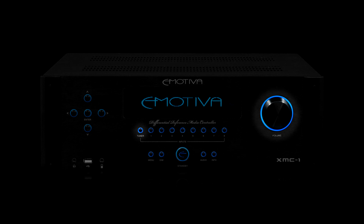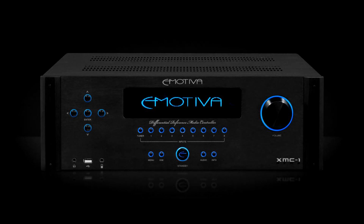To tune to a different frequency, turn the volume knob while holding down the tuner button. This works just like spinning the tuning knob on an old-fashioned tuner. To seek to the last or next station, use the left and right navigation buttons instead. To switch between AM and FM bands, press the Enter button while holding down the tuner button.